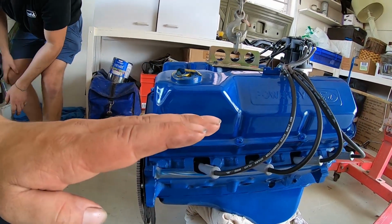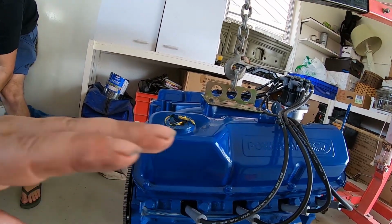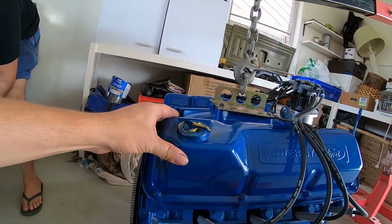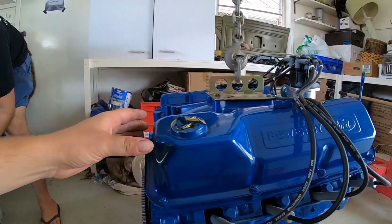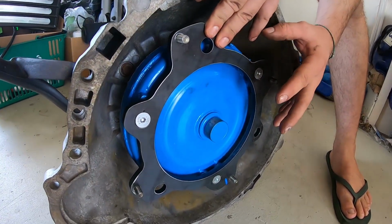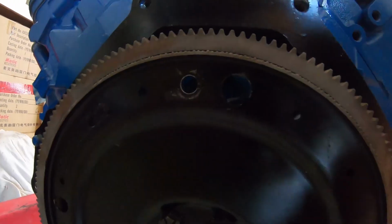So when you pick the box up, you're fitting it with the converter in like this. If I hold the box level, the converter will fall out, and if the engine moves, you don't want that. This has to be pretty stiff. That's even a bit floppy for my liking, guys, but we'll have a go. As I'm moving this, my hand's going to push the converter in. We do not want this coming out, alright? Is this lined up perfectly in the middle here?